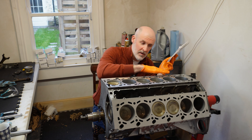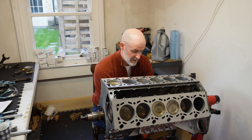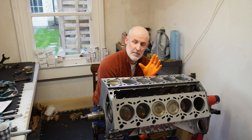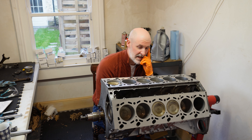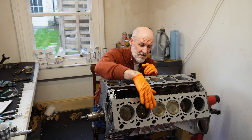The deck is falling away as it graduates towards the rear of the block. I'm absolutely raging. I have done nothing wrong - the bottom end assembly has been absolutely perfect. The conrods and pistons share the same journals from one side to the other since the crank goes through the middle, so you can't have one side off and the other not. The only thing that's wrong is the machining. I've been on to the machine shop about it, kept it all in email to keep it formal. They've basically said the level of machining I'm claiming is out by would be physically impossible for them to do - which is absolutely not true if you didn't have the block properly levelled in the jig. They were maintaining they took off a maximum 0.08 to 0.12 of a mil, but we're out from front to back by 0.4 to 0.5 of a mil. It's way off.